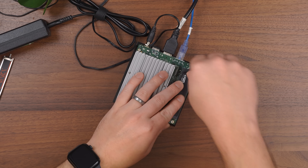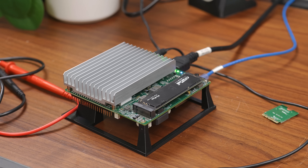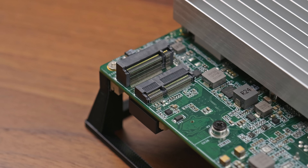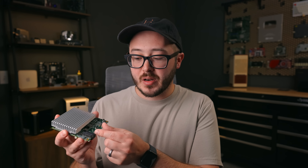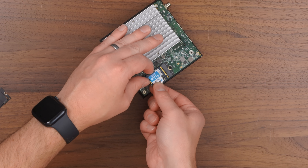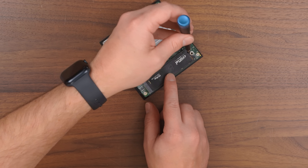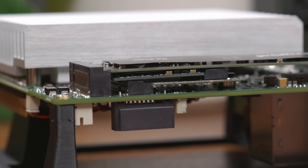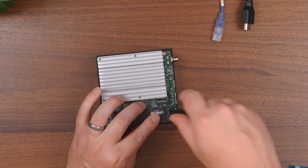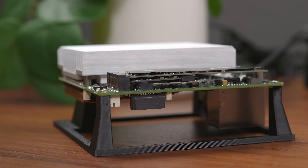I was a little bummed I had to use the M.2 M key slot for the NVMe SSD, since it would be nice to have it free for something else — like a 2.5 gig NIC adapter. Normally I'd use the E key slot for adapters, but it's in an awkward spot underneath the M key slot, so installing a larger adapter there would block the NVMe. I did find that with a very specific E key to M key adapter that reverses the orientation, I could just barely squeeze in an NVMe 2230 SSD — though I couldn't even screw it in and had to rely on another NVMe SSD on top of it to sandwich it in place. That actually worked, but long-term thermals probably wouldn't be great with two NVMe SSDs literally touching each other. I experimented with a thermal pad between them, which bent the top SSD slightly, but the idea of using a heatsink on the top SSD with a thermal pad might help draw some heat from the bottom one.